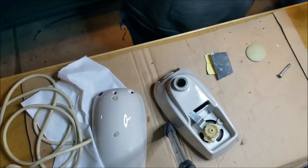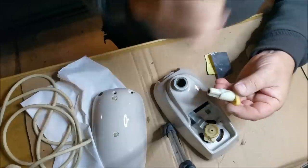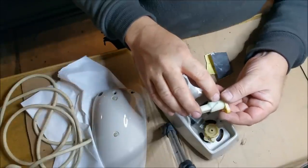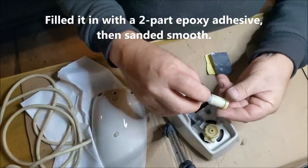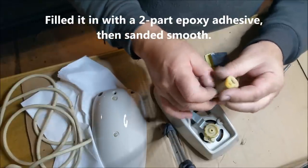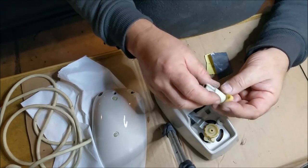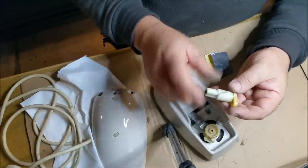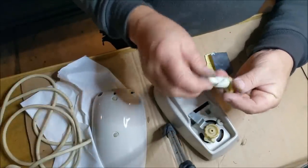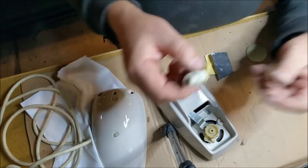And they can sit. So I've got the pivot for the lower housing. Oh, actually, it's the pivot for the head. And I've drilled out the end of the crack and dug it out with the Dremel, and also around that part there. Thankfully, there's a steel pin through it, which a screw goes into. So if it cracks or gives any trouble again, the head of the fan will get a bit wobbly, but it won't break off. Having said that, if that does happen, this isn't a difficult part to make from Delrin, which will be a lot tougher than that.